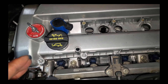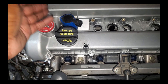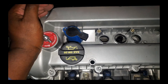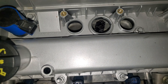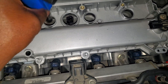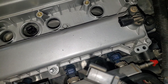Alright, so we got the valve cover back on. The three bolts removed from the cams — one, two, and three — have all been torqued down to their correct specifications: hand tight, then 62 inch-pounds, and then 144 inch-pounds across those three. So make sure you do that if you watched my first video and installed yours wrong as well. I'm very sorry for that. Also, another subscriber pointed out something interesting: instead of installing the coil pack on cylinders two and three first, go ahead and install your clip or pigtail for the temperature sensor — it makes it much easier to get in. Let's go ahead and give that a try.